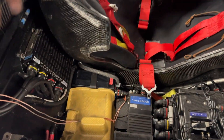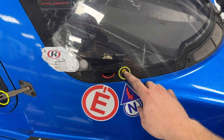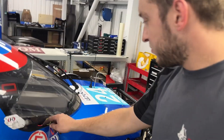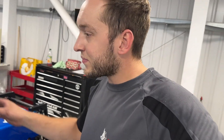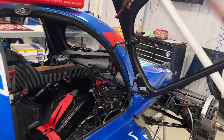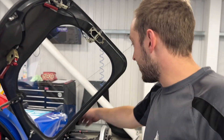The master cylinder in there is to do with the Marshall safety system. If we look outside of the car here, you've got the extinguisher pull button and then you've got the master switch button there which kills all the power. So in the event of a crash, the Marshalls can come up — if the driver's already got out or the driver's unconscious — they can pull the extinguisher from here and then kill the power. In killing the power, it also throws the car into neutral, and that is what the fourth master cylinder is for. It throws it into neutral so if the car stops at the side of the track in first gear, the Marshalls won't know the procedure with the gearbox button on the dash, so they have that button which just throws it into neutral and the Marshalls can then push the car out of the way of the circuit.